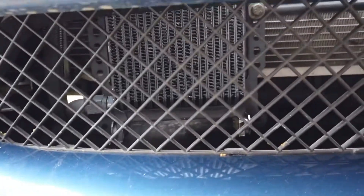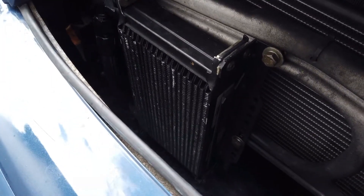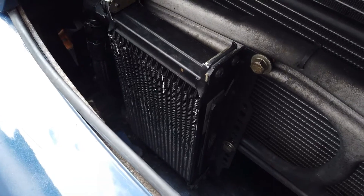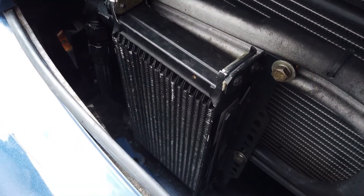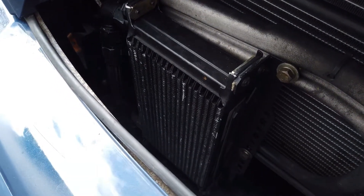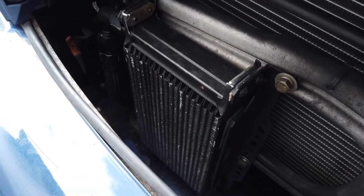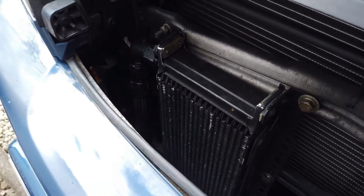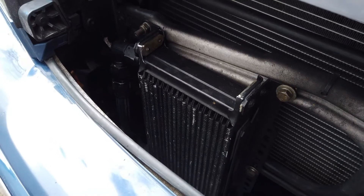Part of it is covered, which is why I went for the slightly wider 19-row. You might get away with a 10 or possibly a 16-row as well. But on this car, it's going to run for a long time — flat out up to max revs, especially in club enduro races of two hours. So I went for slightly larger. I can always downsize it if need be, but I want the oil to remain fairly cool.